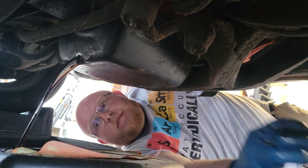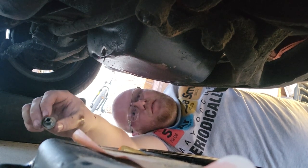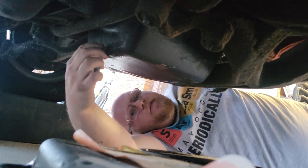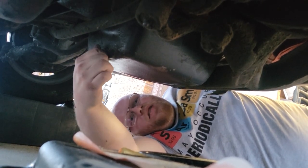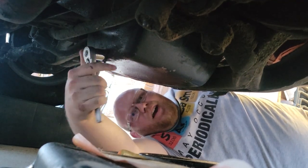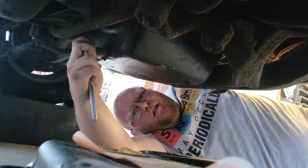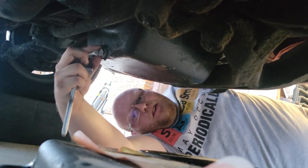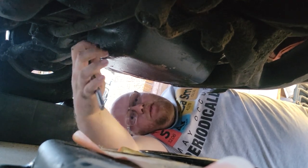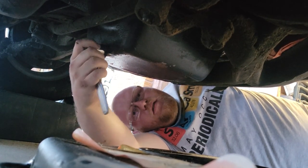We got that new gasket on the bolt. We'll plug her back in. We got just a little drip drip here, so we're gonna go ahead and start hand-tightening it back in our oil pan. After I get this in I'm gonna clean everything up a little bit — it's good to not have burning oil smell coming into the cab. Take our three-quarter inch ratchet and tighten it down tight so we get a good seal with our gasket on the bolt, then go just a quarter turn more and we shouldn't have any more oil leakage.